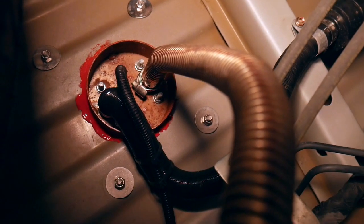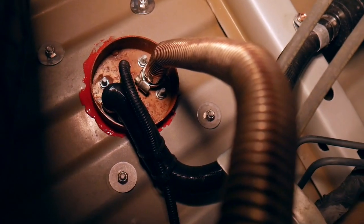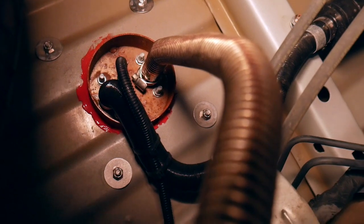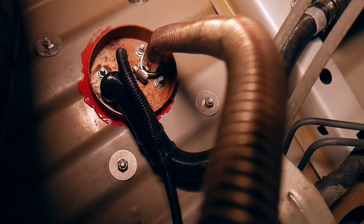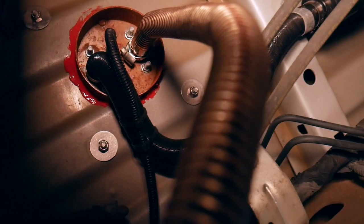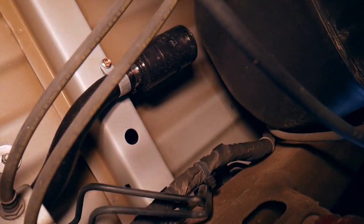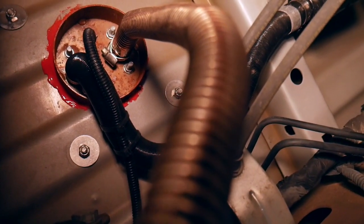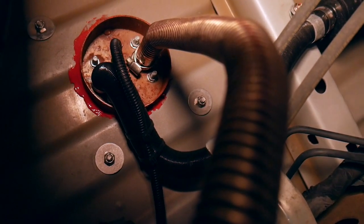This is the turret plate I was talking about — that's the round piece that comes through the actual truck bed. That makes everything a lot easier to install: you drill one hole, bolt the unit to the plate, send it through, and then the red high-temp silicone ensures no exhaust gases can get up into the truck where you're sleeping. That larger black pipe is the fresh air intake for the unit, that's the filter there to keep debris out, and then you can see where the fuel line in the loom tubing goes up into the unit itself.